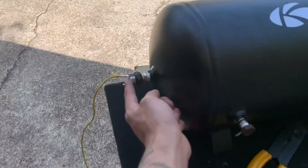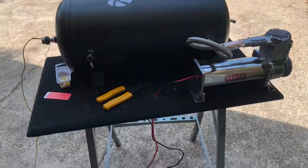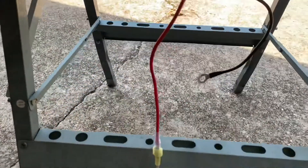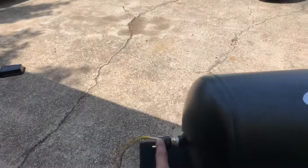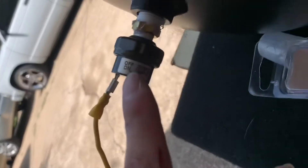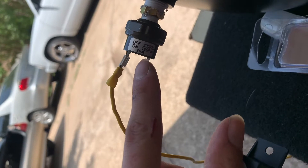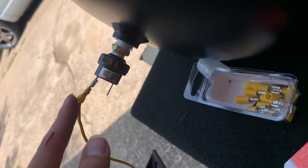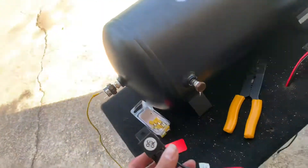He's running the red wire to the ACC. So how does it work? When the relay gets power, the pressure switch will kick on. When it hits 200 PSI it will cut off, and when it drops to 165 PSI it will turn back on. It needs 20 amps — the ACC is 20 amps. The ACC is just a signal to the relay so the relay turns the compressor on.